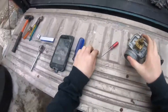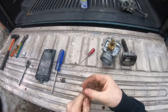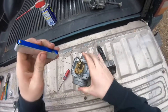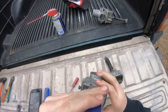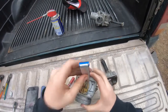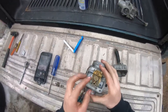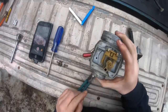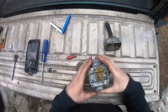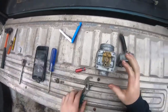Okay. And the hole is not so bad, so I just use a pipe cleaner thingy to get all this stuff out from in there. Alright, so I got the high-end jet, or the tall jet, or the big jet, whatever you want to call it, and then I got the small jet. So now it's time to take apart the needle valve, the seat, and the float.